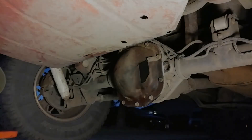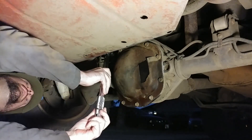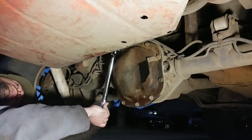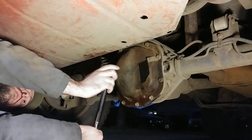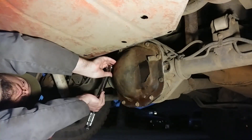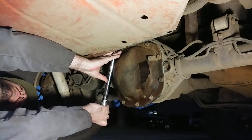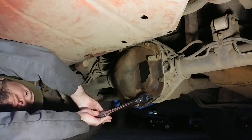After one hour has passed, it's time to tighten the bolts to the correct torque specifications. This can vary depending on what axle you have, but if you don't have a torque wrench, just make sure the bolts are snug — they don't have to be really tight. The torque spec for these bolts on my Dana 44A is 30 ft-lbs, but I've read that old bolts on these axles break easily, so a lot of people only tighten them to 25 ft-lbs, which is what I did. Tighten the bolts in a criss-cross pattern to distribute the pressure evenly.